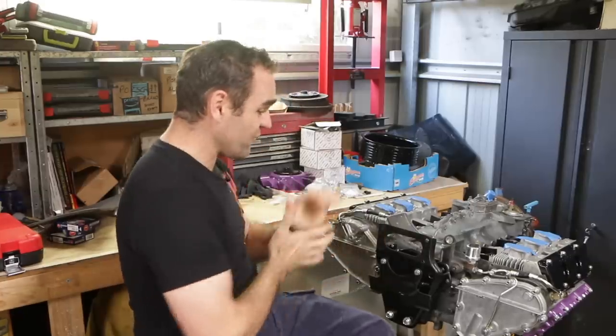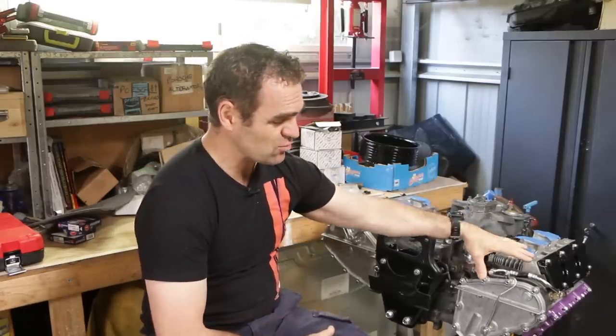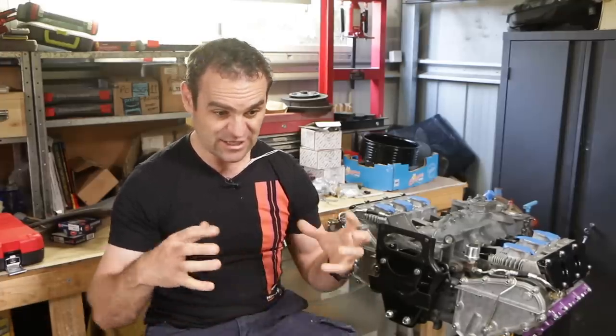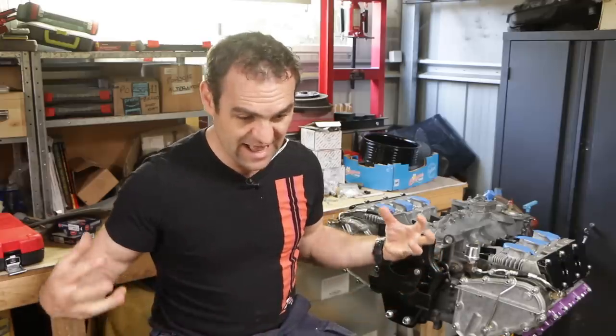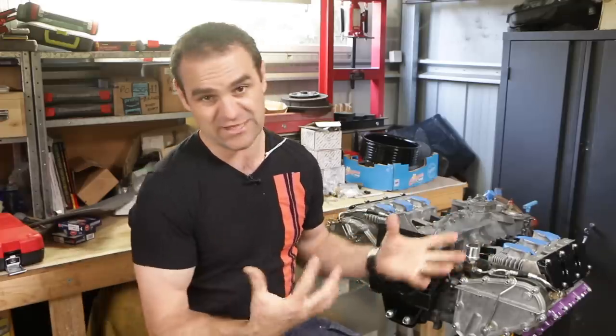Now getting into today's episode — we are finally tackling the ignition system on this car. These engines, particularly with the big domed head, really suffer from lack of spark. As I've said many times, one of the best upgrades you can do on a standard car is a good big CDI box, like something from CAST Classic Retrofit. They do a really beefy CDI box and that will give you a much bigger spark. The bigger the spark, there's potentially quite a lot of horsepower left on the table just from the factory ignition system.